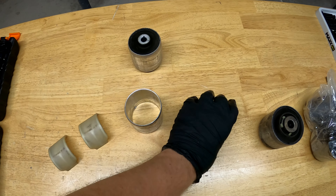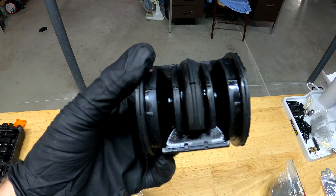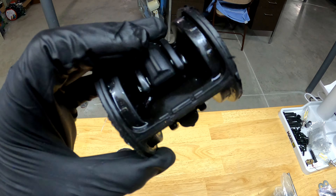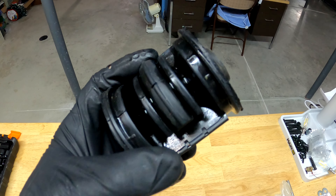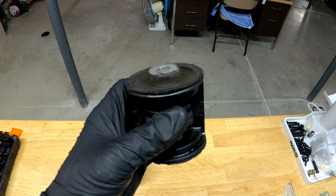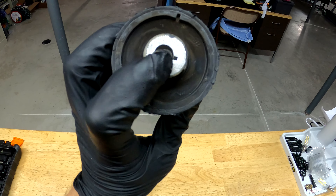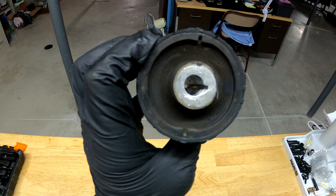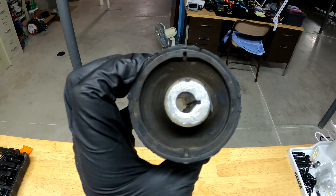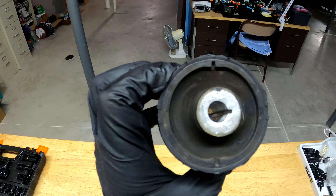What's really interesting is, if you look at the construction of this — there is an orientation as to how these go in the vehicle, how they're mounted in the thrust arm itself. And if you recall, that dash mark, or that slot, it points to the rotor, or the spindle rather, kind of up the length of the thrust arm.